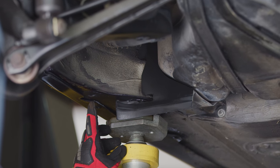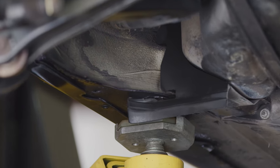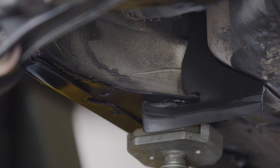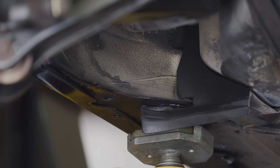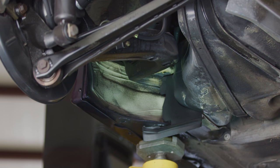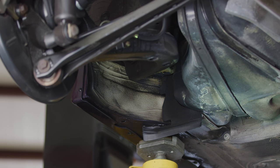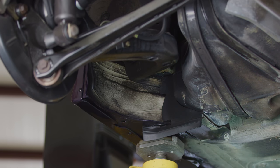So this is pretty cool. It's a drain hole that was plugged with cosmoline. So we're absolutely doing a service to this car by getting that drain hole unplugged. You might have noticed I left that area and there was still cosmoline inside that drain hole. I didn't want to just get crazy because I've got a hard edge. I don't want to take any techno violet off there. So I left it alone, let it get to room temperature, let it swell a little, lose some more adhesion, go back to it, hit it again, knock it out, preserve the paint.